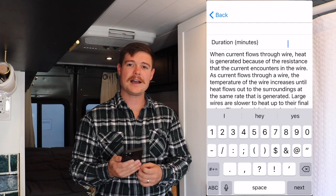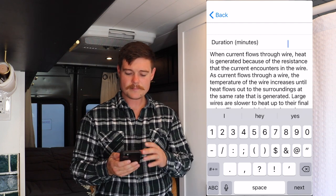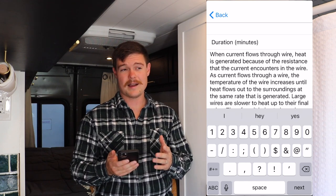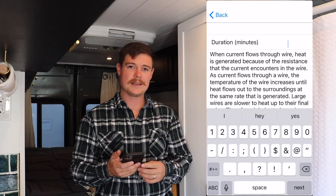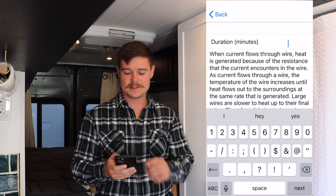And then it'll ask you, how long are you going to run the load through the system? And for the case of our refrigerator, it's going to run 24/7. So I'm going to put the total number of minutes that is in a day. So that's 1440 minutes for a single day.